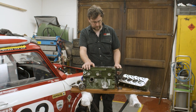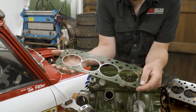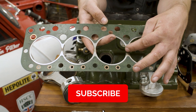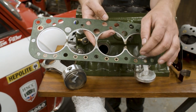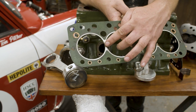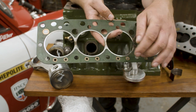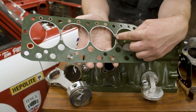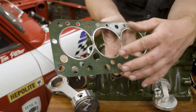I'm going to show you the head gasket first and talk a little bit about it. If we look at this head gasket we can clearly see that we had a failure here across cylinder 4 and 3. The second thing we notice is the bluing and distortion between cylinder 1 and 2. Looking at this side of the gasket, we see the failure point but not so much indication of bluing.